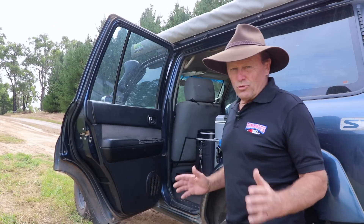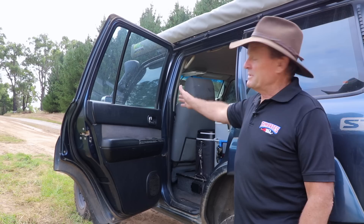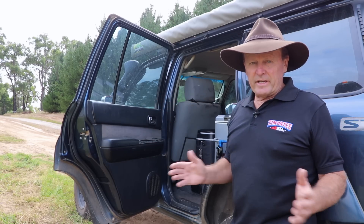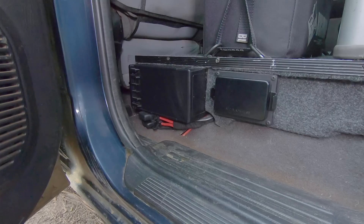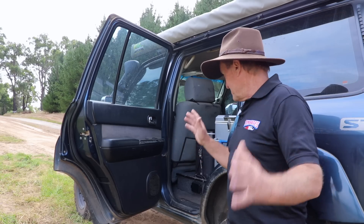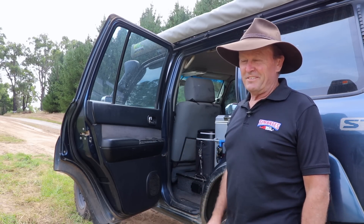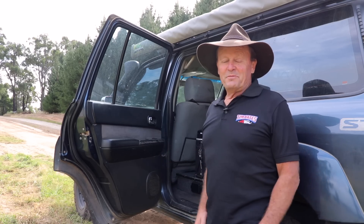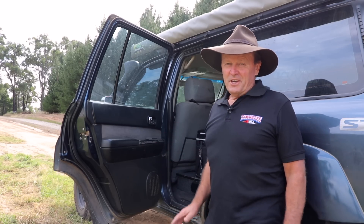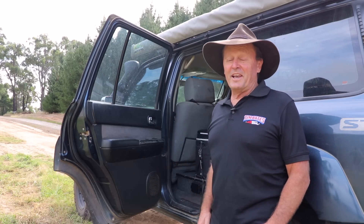For those of you that saw the first video I made when I changed my dual battery setup, I had a lead acid battery mounted under the bonnet and then I went to lithium — a slimline lithium battery — and I mounted it down underneath there. Great place, slimline battery, tucked in under my false floor. Absolutely great location, but I had it lying down. Emphasise the word lying down, and I think that's where potentially the dramas began. Down in that location I've now had two slimline lithium batteries both fail within 11 months.